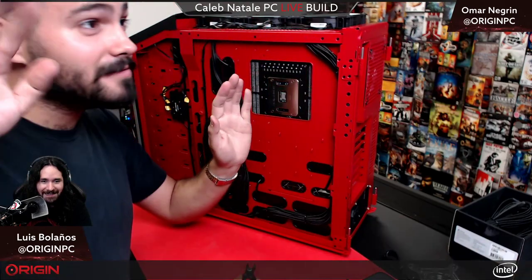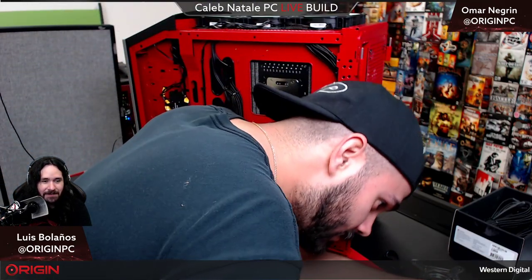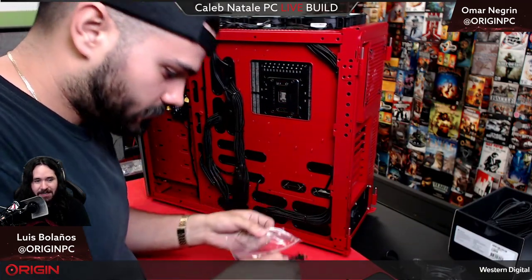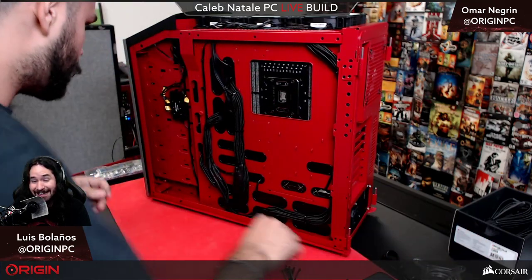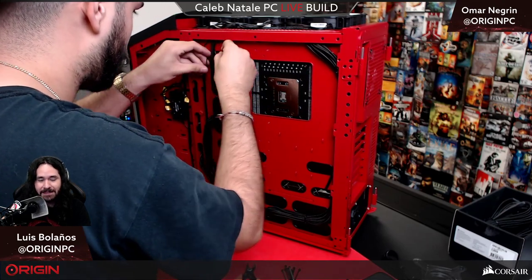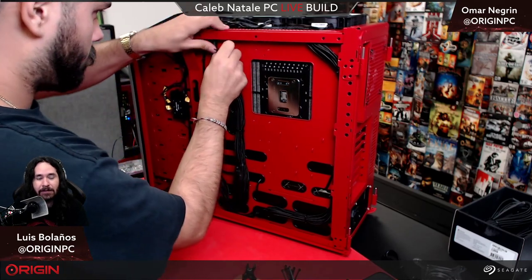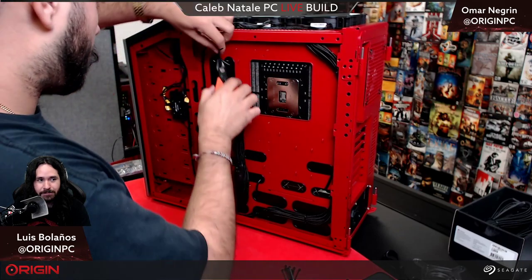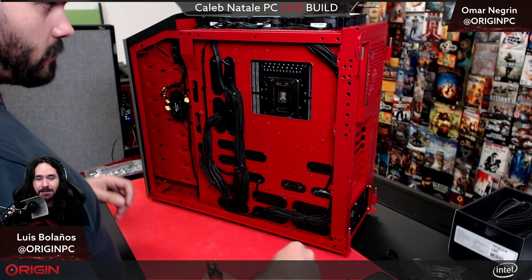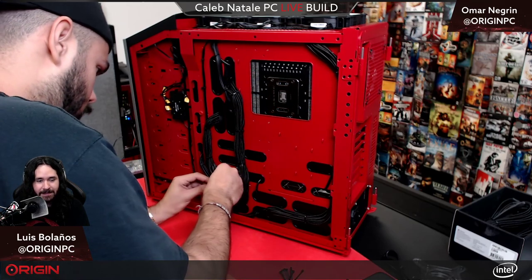I have a thing on my PC that tells me the temperature of my CPU, and for a while now it's been reading 10 degrees higher than usual. Do you think the thermal paste needs to be replaced? Chameleon, I would definitely check another application just in case. If that other application says the same thing too, definitely reapply thermal paste and check the cooler. I don't know what cooler you have, but if it's an all-in-one cooler, depending on how long you've had it, it could be time to replace. But if it's a heatsink one, like the giant heatsink with the fan, maybe you want to make sure that there's no dust buildup or anything like that.